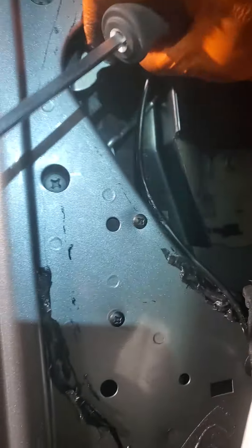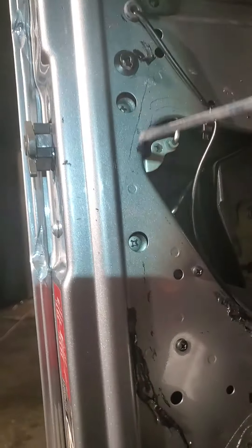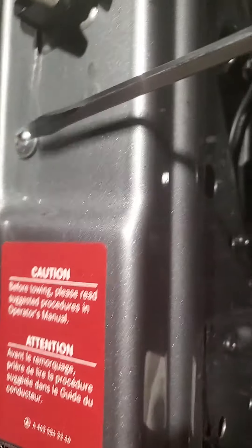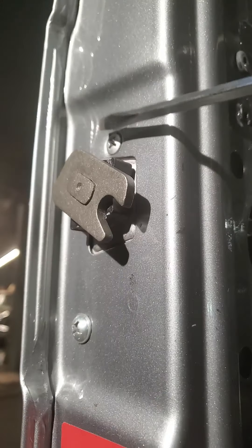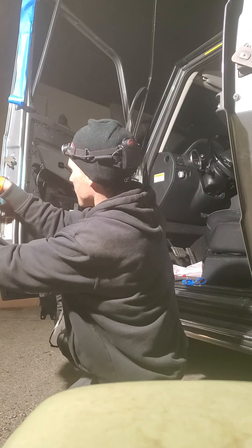Push these clear so that's free to move. Then you're going to need to take out this screw, this screw, this screw, and this screw. This screw is for the door handle outside, and this bolt right here - the door handle on the outside will come off. This screw is for the door.